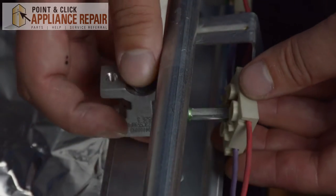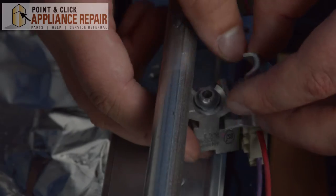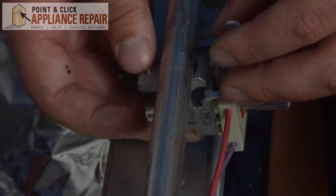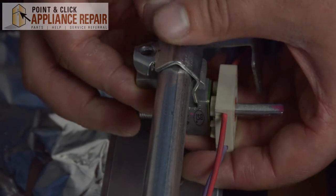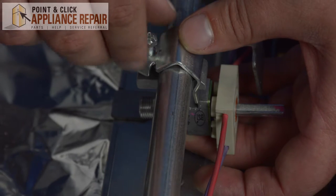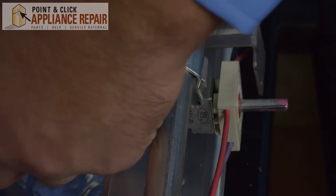Just take the switch and snap it back into place on the valve. Reattach the clip back onto the burner valve. Then using your hands, make sure that you place the valve correctly onto the manifold pipe. Holding with your bottom hand, make sure the valve is straight. This way when you screw it in, we won't screw it in crooked. Once the valve is firmly in place, we're going to reattach the burner tube to the valve.